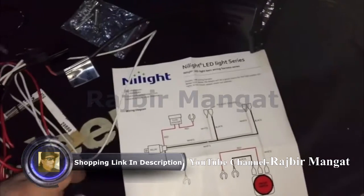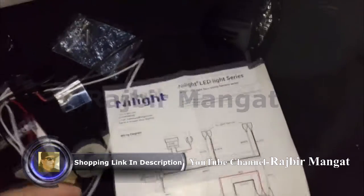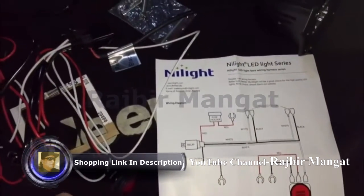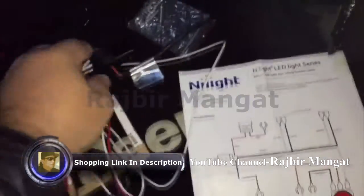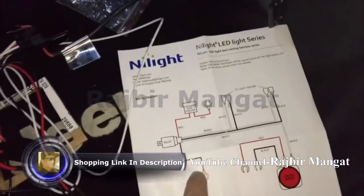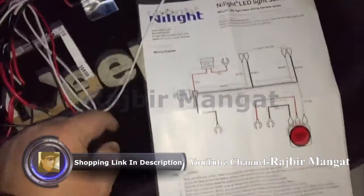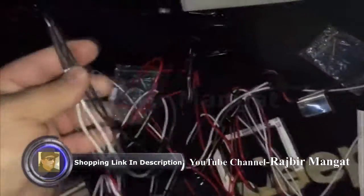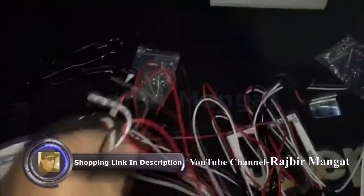The optional wire harness that you can also purchase with your set of lights — I'll put a link for that under the show more description in this video. But it doesn't get any simpler than this. You've got a nice heavy duty switch, it's relayed. You can put your positive and your negative for your relay, same for your switch because this is going to be a lighted switch. You've got separate outputs, one for each light. Everything is already soldered — it couldn't get any easier than this.